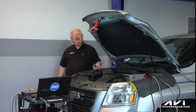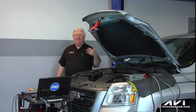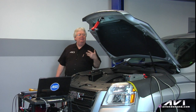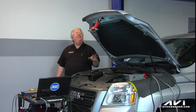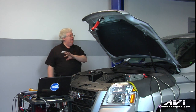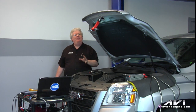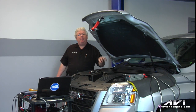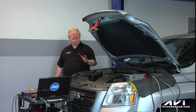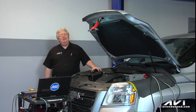After all the resets were done, the codes cleared out. The Prius was back on the road — my wife had her little Prius back and she was finally happy, after yours truly took about a month of Sundays working on it. What we learned in this case study: on a very complex system, you have to sometimes reverse engineer theory of operation, schematics, get any tidbits of info you can, then tear into it. At $1,200 for one module just to get that Prius to stop, we have to make the right decisions in parts replacement — it can easily be thousands of dollars, whether it's a Prius or a Jaguar with adaptive cruise control.